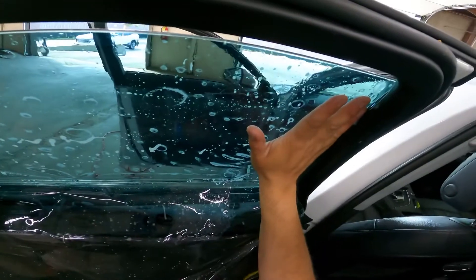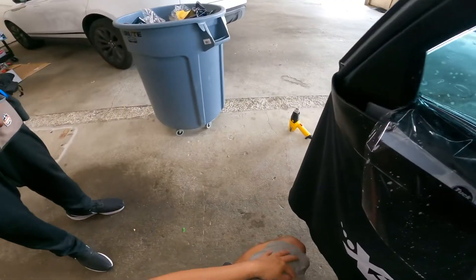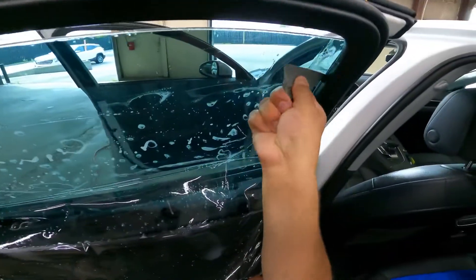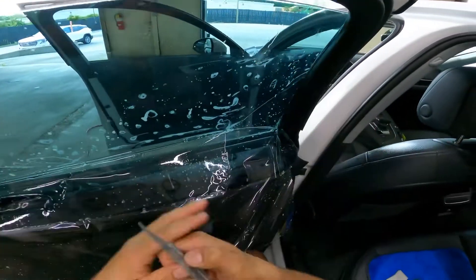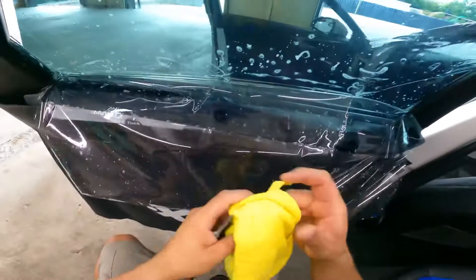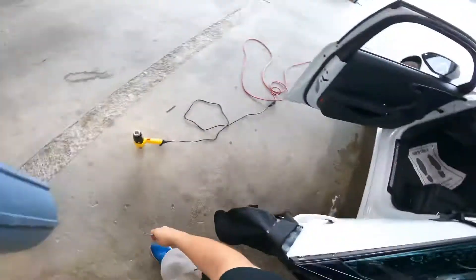I can hear it's already drying. Good gap. I'm going to get my gray bondo — center out, just the top two inches, go up. Center out, center out, center out — you always want to go up on these corners. If you squeegee down, you're literally going to force more film down at the bottom and create fingers that never existed. Clean the glass to make sure I'm pushing out all the moisture.